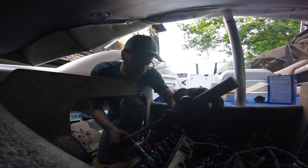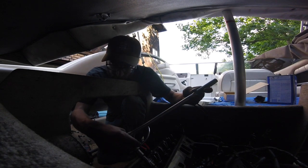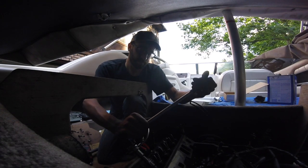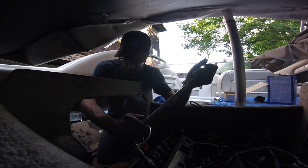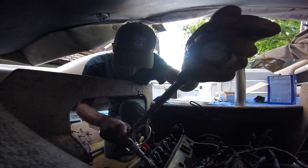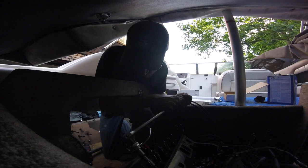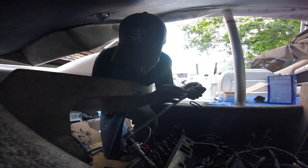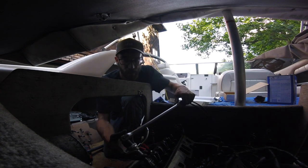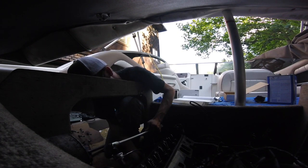And you just continue with your torque sequence. Go to this one, reset back to zero, and hit this one at 75. You can take this off and reset. Shouldn't change your angle. 75. Okay, so now we're gonna do the lower one. I've kind of already memorized the sequence here.